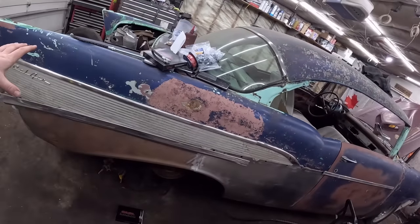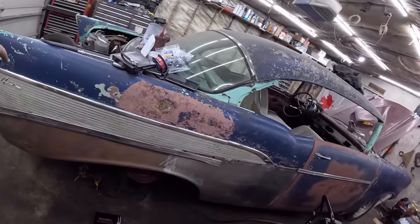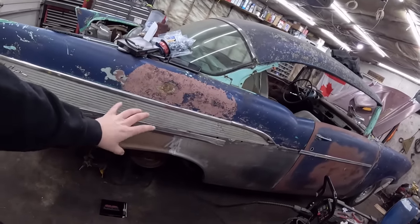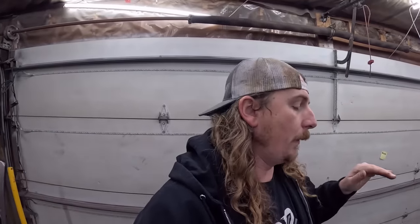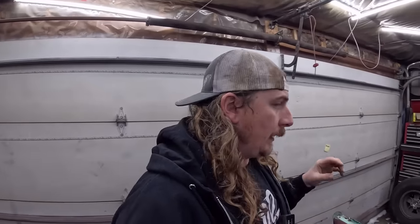So basically we're going to start away at the back and work our way forward. We need to run brake line, fuel line, and I guess the electrical to the fuel pump. The pump will be somewhere back here. Electric pumps, they don't like to suck, they like to push. So closer to the tank, and if you can get it below the column of fuel, whatever you want to call it, so it's kind of like siphoning in once it's primed, is absolute best. I think I have a pump on the shelf, so we kind of get that going.